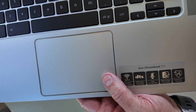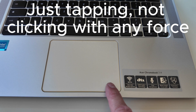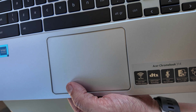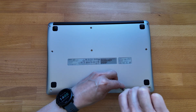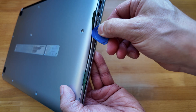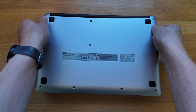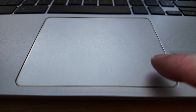I've seen this on new and refurbished Chromebooks and it's just bad luck. I wish there was more QA done on these to avoid it. My advice would be to just send it back and exchange it, but I decided to take a look inside instead. Accessing the upper hinge wasn't straightforward, but I found a quick fix was a very small pad of foam under each of the closest hinges to raise the touchpad up a bit — and now it feels perfect.